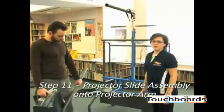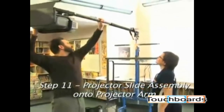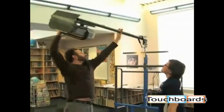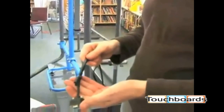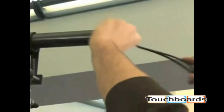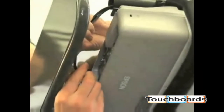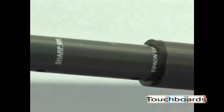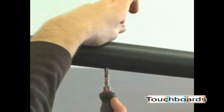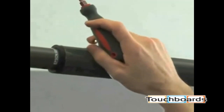Now it's time to install the projector arm assembly. When sliding the assembly into the projector arm, make sure it goes all the way in and sticks out the back. Stagger the female end of the projector power cord just behind the head of the male end of the VGA extension cable that came with the iRover, and wrap together with electrical tape. You can now feed the cables through the arm tubes without any binding or friction. Once the cables are all the way through, plug them into your projector. Using the labels on the side of the projector slide, line up the holes for the appropriate projector-board combination. Insert a screwdriver from the bottom to clear the cables out of the way and use as a guide to insert the bolt from the top. You may need to use a rubber mallet to tap it in, making sure it is clear of the cables.